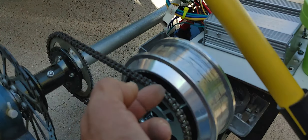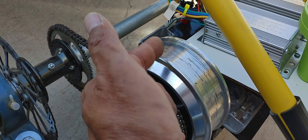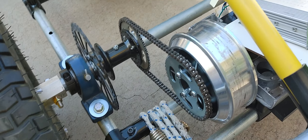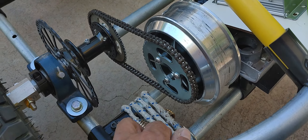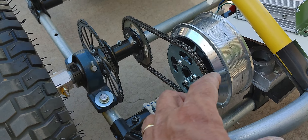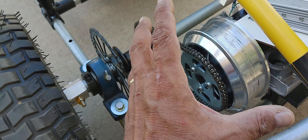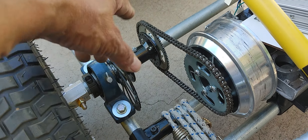The gear ratio here is one-to-one because I'm driving on this one — it's direct drive, basically one-to-one, which is what I tried to achieve because I could not fit this directly to the wheel as I wanted. I didn't want to risk the interior windings by going with bolts inside the motor disc. That's why I did it this way, though I may be able to make some kind of adapter for a hub and go to direct drive.